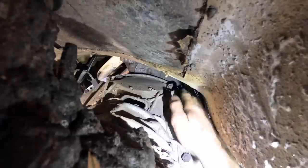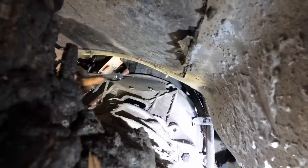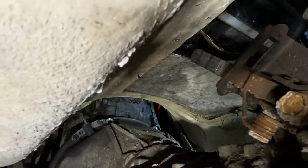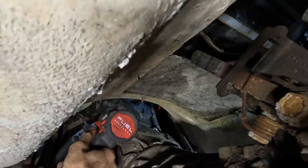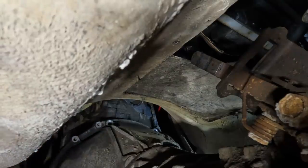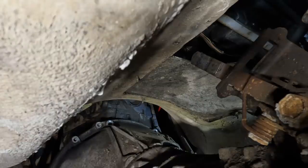I wonder if I'm going to find original clutch parts in this thing — it's possible. That one's easy to reach from over here. Just a couple bolts left, guys. This trans is coming out. We are still on the bell housing over here on the driver's side. I'm going to pull the crankshaft position sensor off. That's a bolt inside of the bell housing. That's what you don't want to do when you're not removing a transmission — if I was just replacing this sensor and I did that, we'd be pulling the trans out to get that bolt out of there. Or fishing it out with a magnet. Anyway, it's almost all the way unbolted.